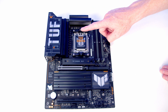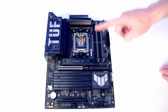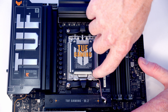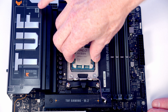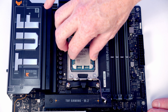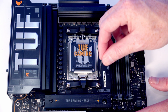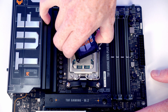We're now ready to work on the motherboard, installing the CPU, the brackets for the CPU cooler, the M.2 SSDs, and the RAM before putting the motherboard into the case. To open the socket cover, push the lever down and out to bring it towards the middle of the motherboard, then open the socket up. Lower the CPU into the socket with the text the correct way up, wiggle it gently to confirm it's seated correctly, then close the socket cover. As the lever closes, the black plastic piece should pop off — keep it in the motherboard box for safe keeping.